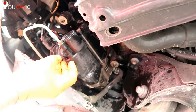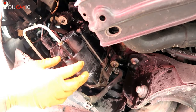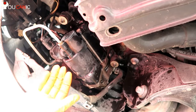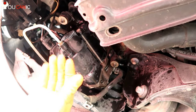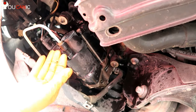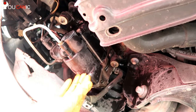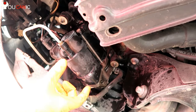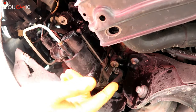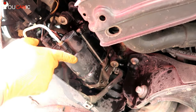Now another problem that's a little more difficult to diagnose: sometimes the air compressor might work, it might kick in and sound like it does, but the problem is that the compressor is worn out and does not generate the required pressure. If you run a test on the compressor, it's supposed to bring the pressure to a certain level within a certain period of time — usually about 15 seconds. If it doesn't bring it up, the Airmatic system will throw you an air suspension error.